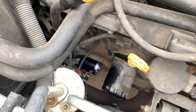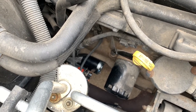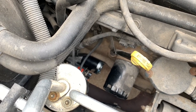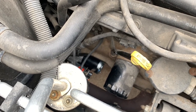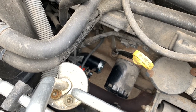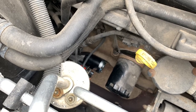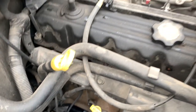Wait, you took the battery to a place and they tested it? I tested it with a voltmeter. What did you get? 12.46 volts. That would imply based on voltage it was good, right? Yeah, but there's one problem — a battery can show 12.46 and have cells that are messed up, which causes the amount of amperage it can produce to be bad.